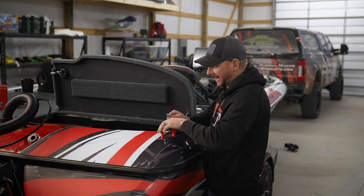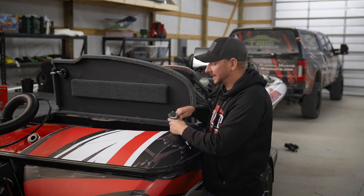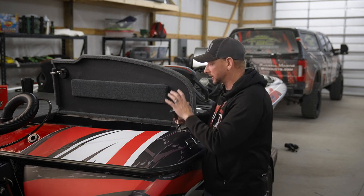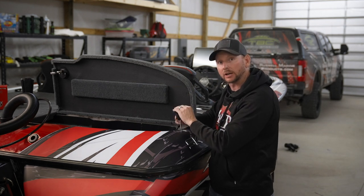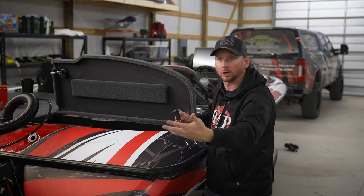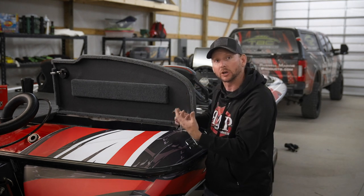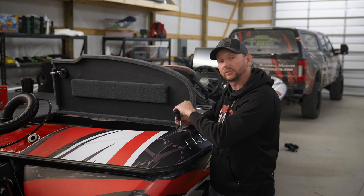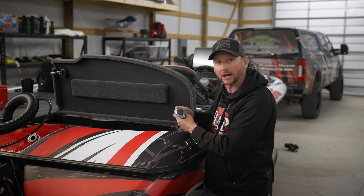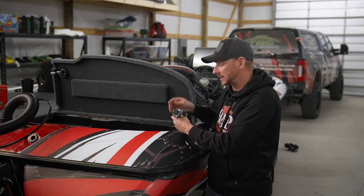The reason I am doing what we're doing here: once we make connection to the boat side, not only do we have our anchor light on our Minn Kota Raptors now functioning, we will still have power to this rear anchor light receptacle for two reasons. If you happen to break our anchor light off on a tree branch or a co-angler on a cast, or if you are running a powered Yolo tech or a powered GoPro mount, this function still has power — so it's still charging your GoPro as well. I always recommend never completely eliminating power to this, but simply splicing into it.